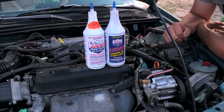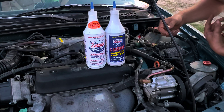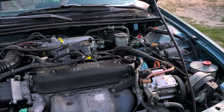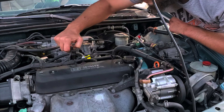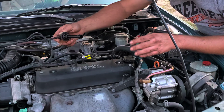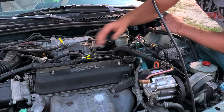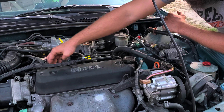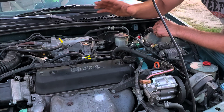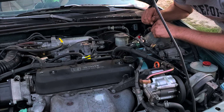On these particular engines — and I've done a video on the valve cover gasket and spark plug well seals — if you're starting to lose a lot of oil but don't notice a drip underneath the car, come out and start pulling up your spark plug boots. If you see oil on those, you've got a problem. It means your valve cover gasket might not be leaking externally, but the seals underneath it are. That will flood the spark plug boots with oil, causing fouled plugs and a lot of issues. Just replace your valve cover gasket and spark plug well seals — I have a video on that too.